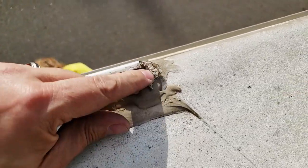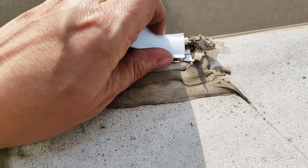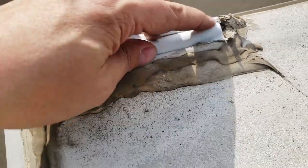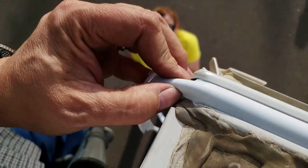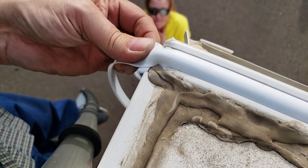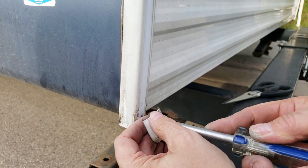Okay, so just trying to make sure that the Dicor is out of the way. Bump is up. Start it in the groove. Right, just pinch it. The corner here is really tight because its edges got crushed as they bent this over, so I'll have to work that in a little bit with a screwdriver. So what I'm going to do now is just proceed forward a little bit, so encourage that in. Just push that through, take the hole.